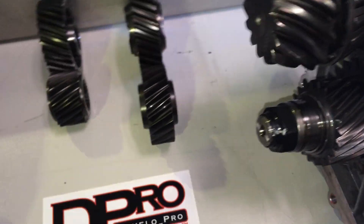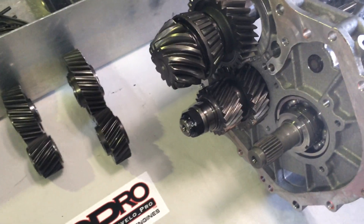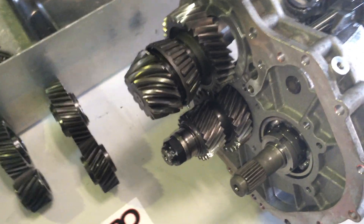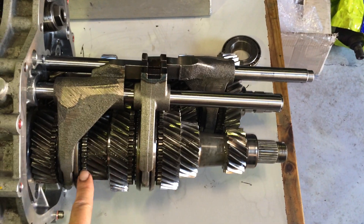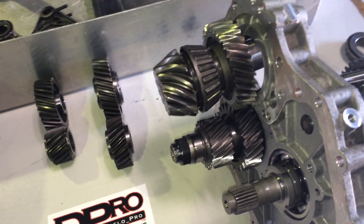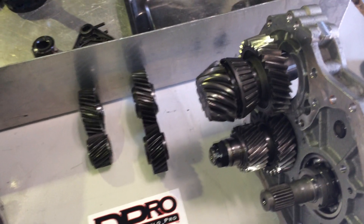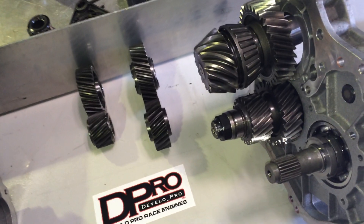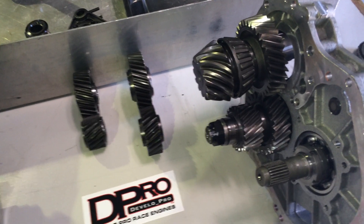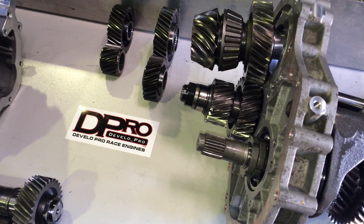Now it's about an 18, 18.5% drop. So what that means is we're modifying — essentially no different to putting a low set of diff gears in any old Chevy car, putting a set of 4.11s in the rear. It drops all of your ratios. Our gear ratios 1 through 6 remain the same, but our overall end ratio is around 18.5% lower. We're pretty sure it's going to bring first gear from 105 kilometres an hour down to around 82, 83. So for guys looking for a good get-off-the-line drag race on the quarter mile, which is getting more popular, or guys just doing street stuff, this is a really good modification. It picks up the 0 to 100 — which we've got to test — and we'll film that and put the results up online when we've got them.